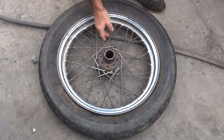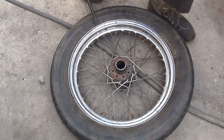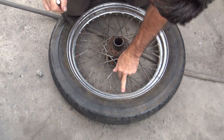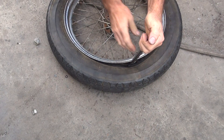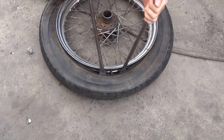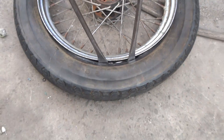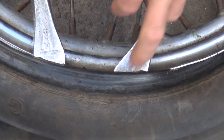Make sure the iron is down inside the undercut so you don't screw up your tube. You come over here, go on that side of the stem and on this side of the stem, then you can bring that up and see how the stem comes out without getting damaged. Make sure the inner tube is down in there so you bring that up without pinching it.